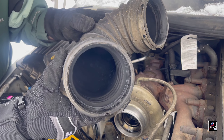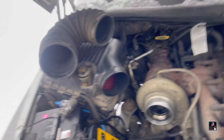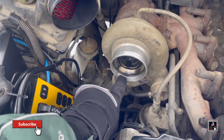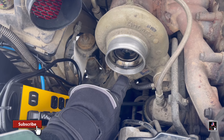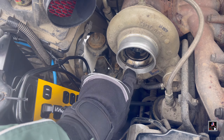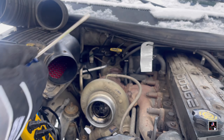If you guys want to see what it looks like inside the tube — after you remove the intake hose, the silencer is right here. There is a retaining wire that goes around, and hopefully it's not frozen so I can get it out. I'm going to use a flat blade, very thin, and try to do it without damaging the turbo.